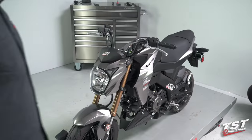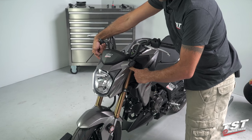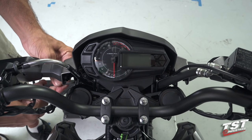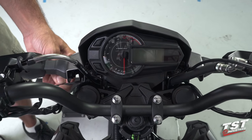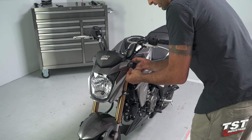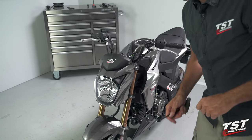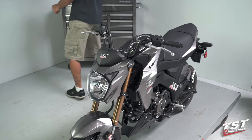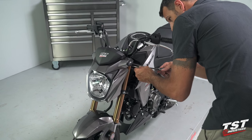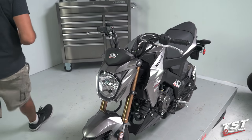Let's begin. The first step will be to remove the two screws from the shroud and the headlight assembly. Those will enable us to pivot this forward and get access to where we need to be. I just want to note that on this particular motorcycle there is no OEM flasher relay — the flasher circuit is built into the dash or instrument cluster. There's no way to replace a flasher relay; there is only a way to piggyback a system onto your OEM system and make it perform at 85 cycles per minute.